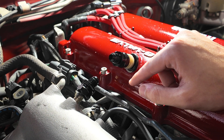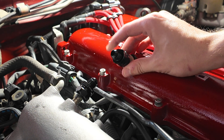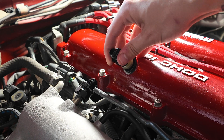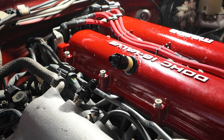It's all done. Here are the fitting adapters - there's a little bit of movement on them, but some of the gasket maker we applied will help. They're going to lock on that barb and they're nice and solid. Now we've got AN fittings attached to our originally hose-barbed system. I think we're going to fit a 90 on here and then a regular hose coming off of this one. These are very close to hitting, but there's a little bit of play in the grommet and PCV valve which should give us the outcome we need once we run the hose and do our oil catch can.